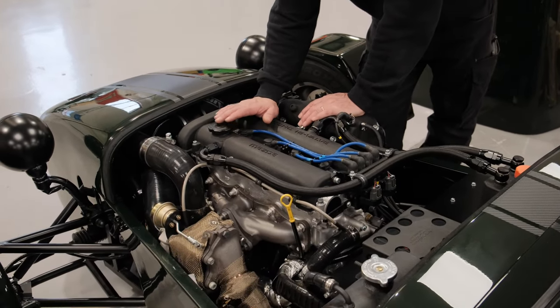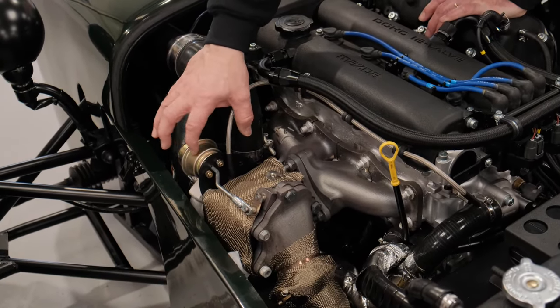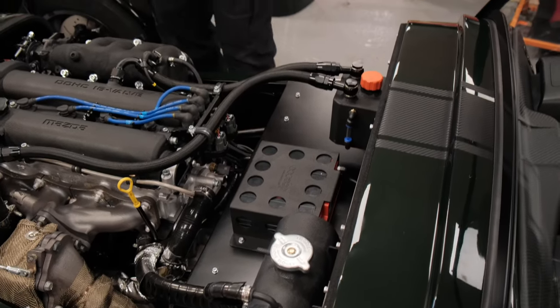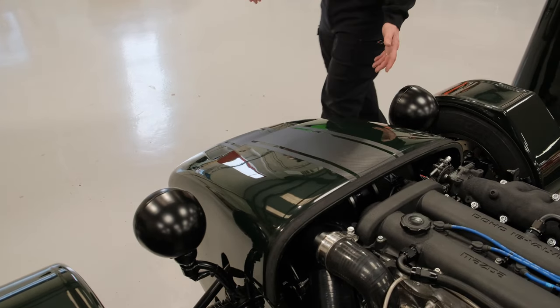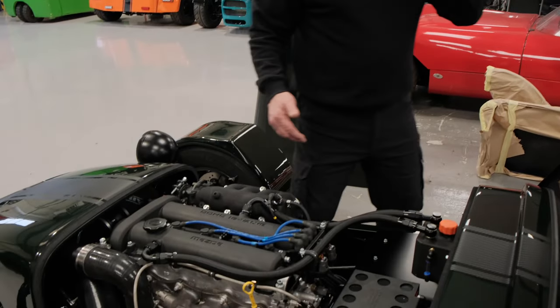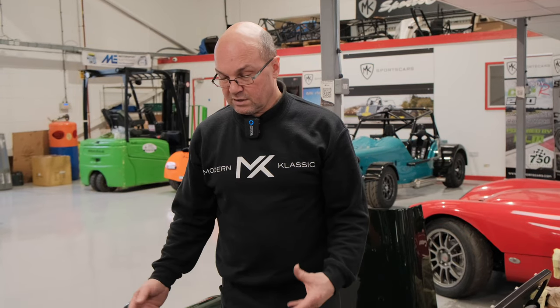So we've got in here a 1.8 engine — we did do a little build on it — it has got forged rods in the bottom end here, and we've got a TD04 19T turbo. Running on the standard wastegate here is, I think, seven or eight PSI, and then we've got a little boost controller under here. On here we've got a PC680 battery, we've got the oil catch tank, our header tank — all of that is standing with our bulkhead, our billet pedal box that goes in there. Pretty much standard Mazda fitment, and a slightly different intercooler setup under here. We're kind of aiming 280 to 300 horsepower on this particular car — with the little button here that says high boost, we can run off the wastegate, and then we'll be able to run highest boost — so we should be able to run this around 200 horsepower-ish on standard, and then hopefully 280 to 300 horsepower.